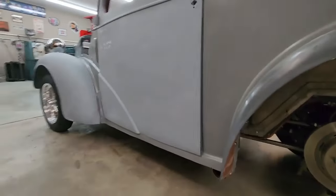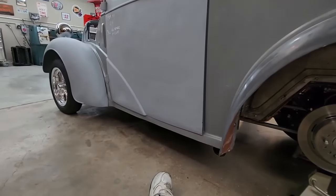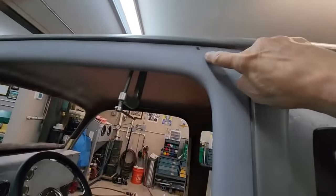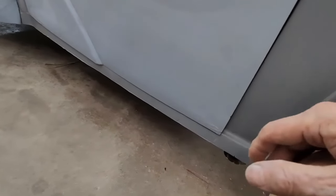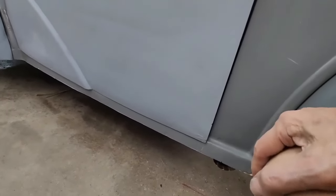Too tall. So we took and measured from there along that line to the bottom of the fiberglass door, and we got basically 47 inches, kind of neat, maybe a 64th more. And then made the same measurement on this door, the steel door, in the same spot, and we got about 47 and 3/16. So what do we make of that? I don't really know at this point.